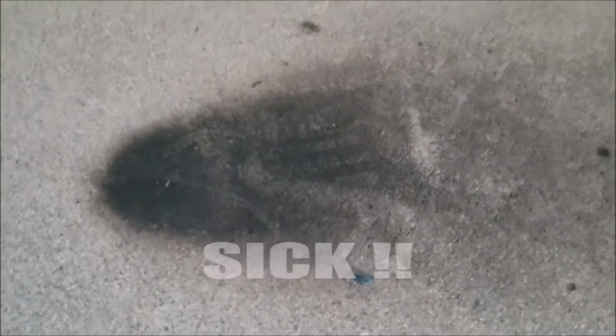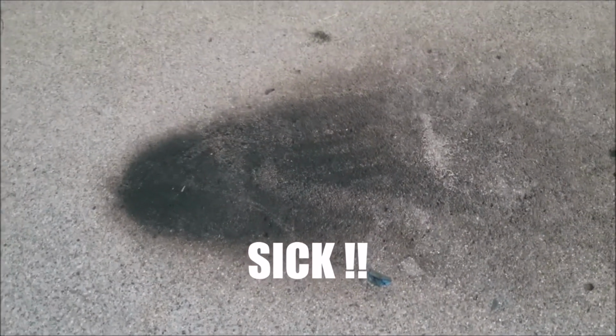I'm a very impatient person, so I could probably say if I would have had to wait for shipping on the gauge to come, I probably would have started it and been blind to this catastrophic issue that I was having. This is soot from when I started the car. It was running so rich. Basically at idle, my AFRs were like 10, and that's about as low as that gauge goes, so who knows if it was worse than that.